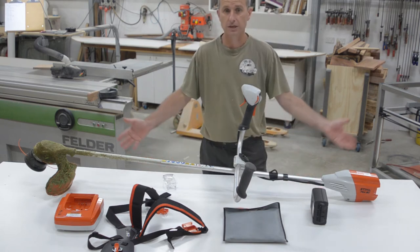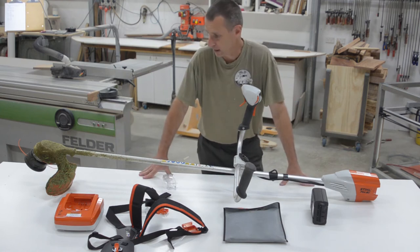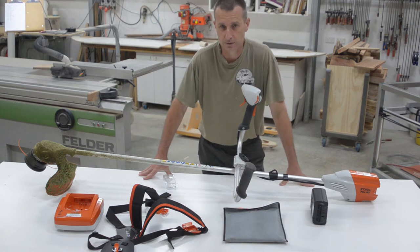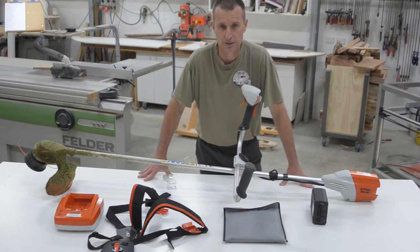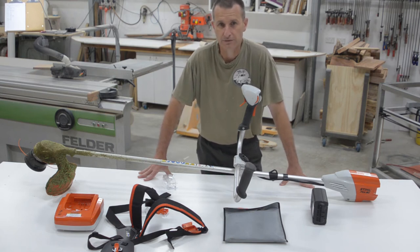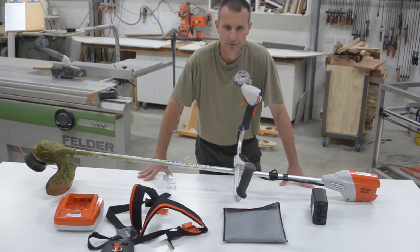Of course, I haven't seen this thing ten years old, but I have seen ten-year-old two-strokes. After ten years you really start needing to pay attention — diaphragms, blisters, fuel hoses, spark plug problems. Also, the engines get very hot when you're working, particularly at the peak of summer, so you've got to let them cool down before you can do anything.